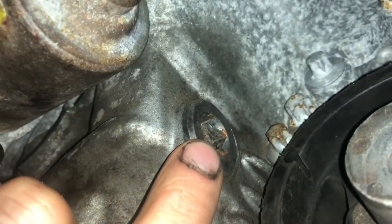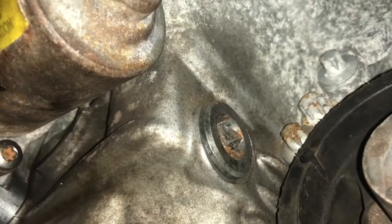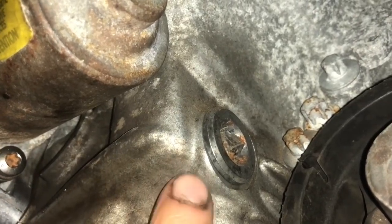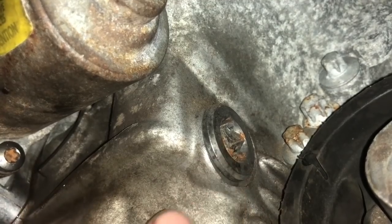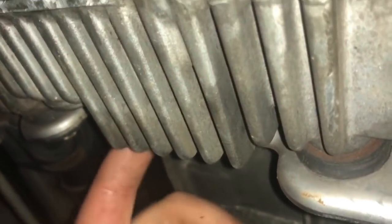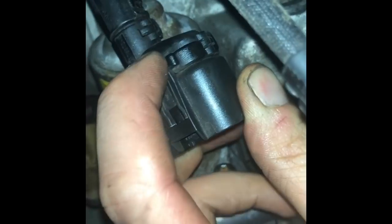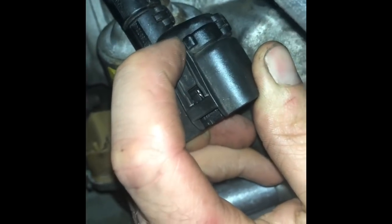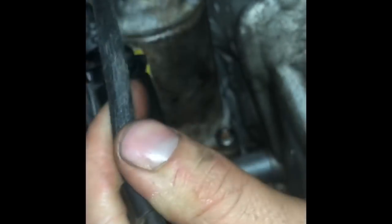It's a 14 millimeter. I just use a custom tool I made — it's two 14 millimeter nuts welded together, and then I use a 14 millimeter wrench to get that off. The drain plug is on the opposite side, it's on this side. This connector is kind of difficult to unplug. You're supposed to press this back to have it release. I broke mine because I didn't really understand how to get it off.